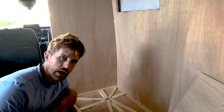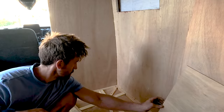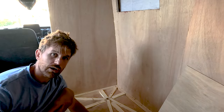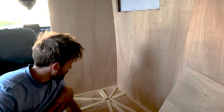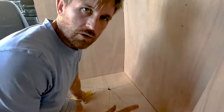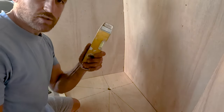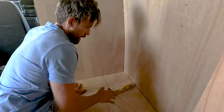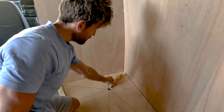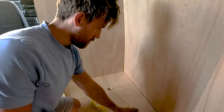So what I've decided to do is build it up in two layers of 5.5mm ply because it just has a lot more flexibility. I've cut another one here and added a few more timbers. I've glued these in position and then I'm going to screw through them and also put glue on top before I put the ply down. Once that's gone off, I'll add another layer of 6mm ply for a nice solid base. The 5.5mm ply has definitely taken the shape a lot better. Checking with a level, I've got some really nice falls running into that drain in all directions. You want to aim for steep falls because quite often the van won't be sitting perfectly level, so you want to over-compensate for that. I'm really happy with how this has turned out.